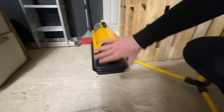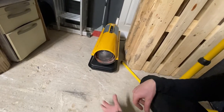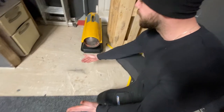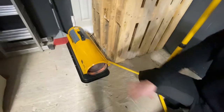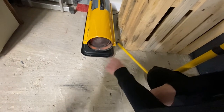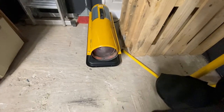Around the heater you start to have temperatures of four to five hundred degrees, and very close to the front it reaches up to 800 degrees. From a safe distance nothing will get hot enough to burn, but as you can see the temperature profile goes from 200 to 500 to 800 degrees. It's ideal to have a clear area in front of the unit. It heats the air instantly — at around 700 to 800 degrees once the element inside goes red, that's the maximum temperature it will reach and it stays like that continuously.